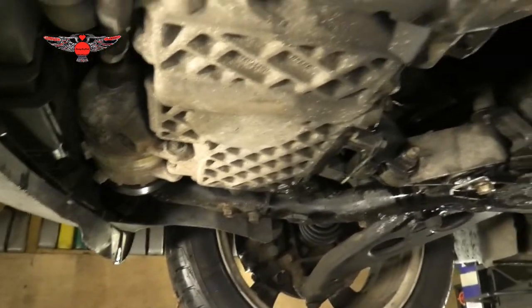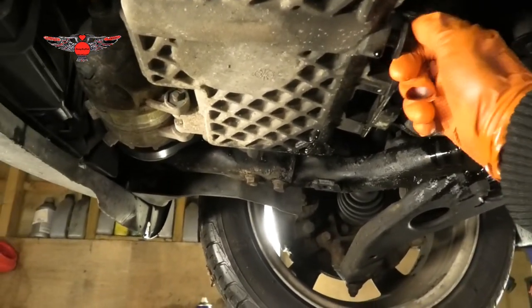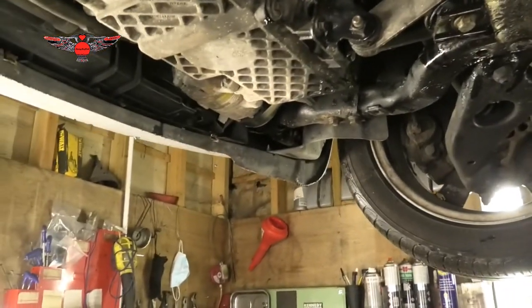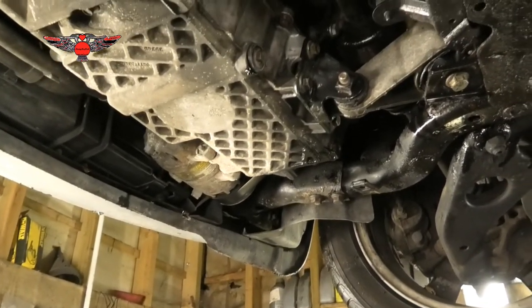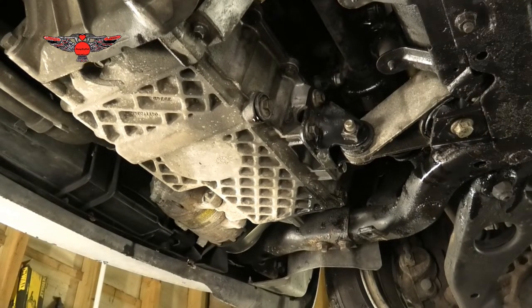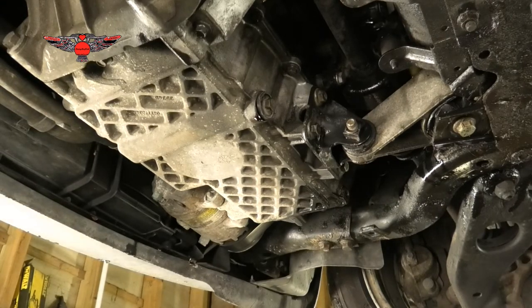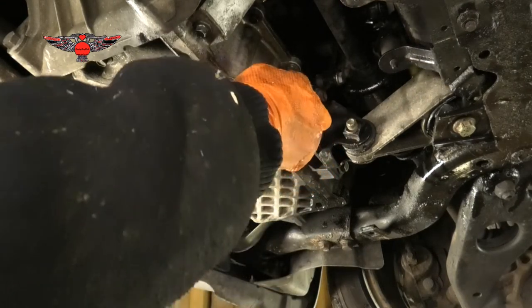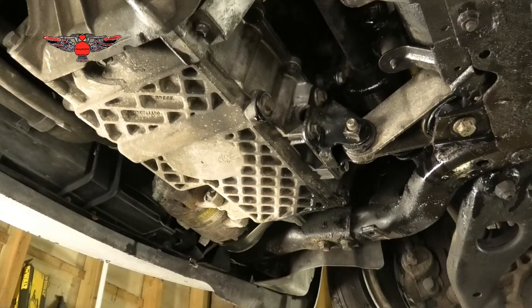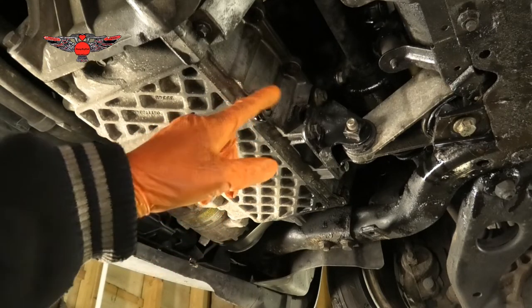And now I have my sump plug bolt here, and I fit that in there. Again, these normally get tightened to similar, 25, 30 Newton meters. No more than that. Some are even less. Some of these days are really low. But this is a 22 years old car, so somewhere along the 20, 25 Newton meters for that will do.